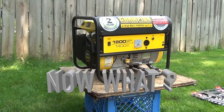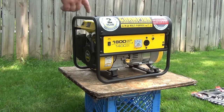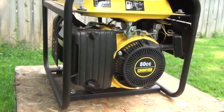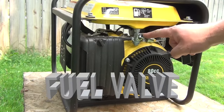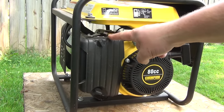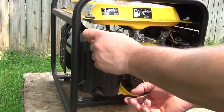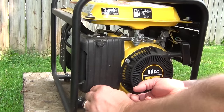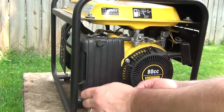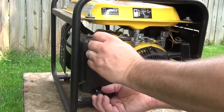We don't hear any ignition there — it just blew past. So first we have to find the fuel valve where the fuel comes out of the tank, and then the air filter. Because this is the easiest, we open this thing up and see if there is anything clogging the air going into the motor, and find an air filter in here to see if there is anything out of the ordinary wrong.